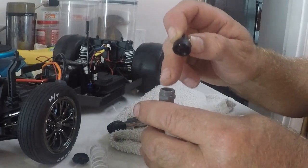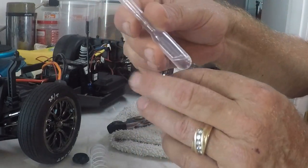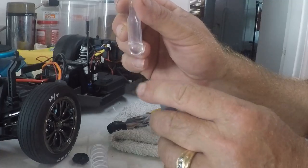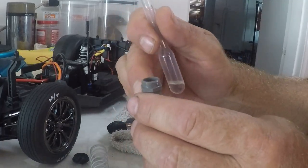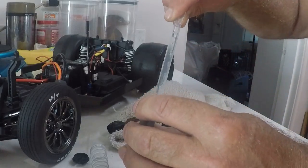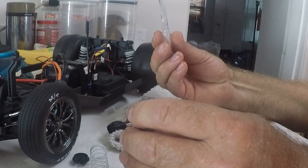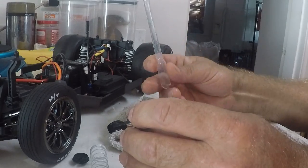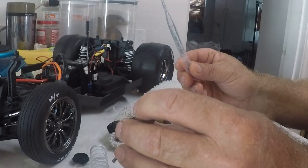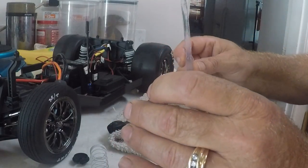The bubble side goes down when you're putting it back together. Then you just take one of these syringes — I did the other shocks already. You're offsetting the area inside of the cylinder, so each one will take a little less oil. All you do is take and vacuum out all the oil with this little eyedropper. Let it go down — it'll take a second. It'll go down a little bit, come out. Squeeze the air out and get some more. That's about all of it.